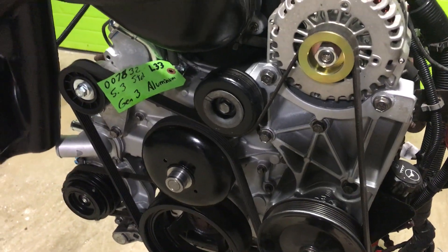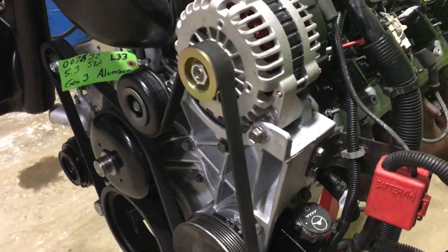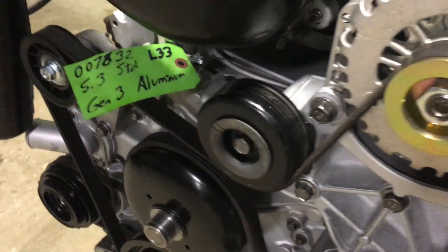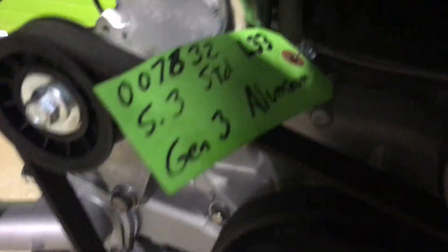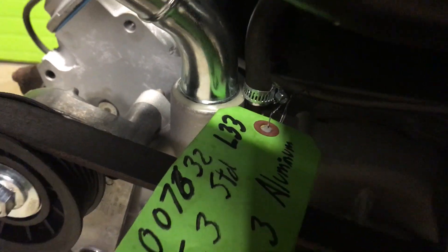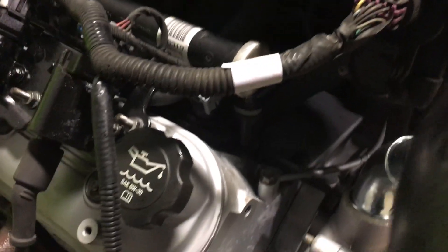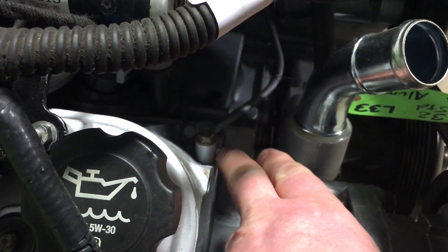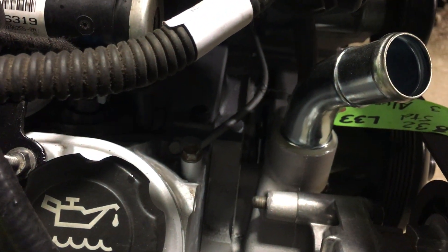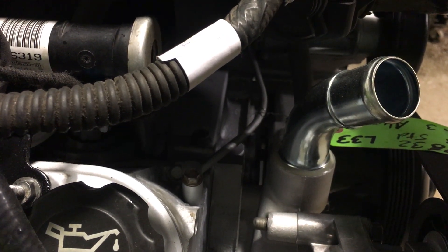As I said, it's a rebuilt engine. Where we've needed to and had the parts, we put a new alternator on it and a new water pump. It has been what we call LSX'd back here, which means we tap into the water pump and run that up to the throttle body — notice it's fly-by-wire — and then into those steam vents, so you don't have to run all the way to your radiator like the original LS truck setup.